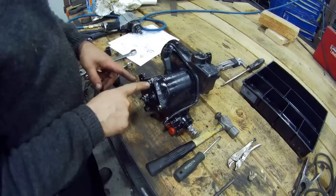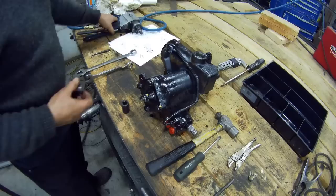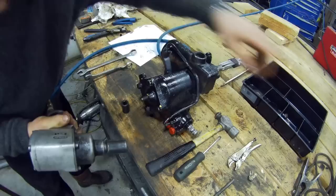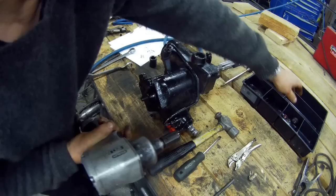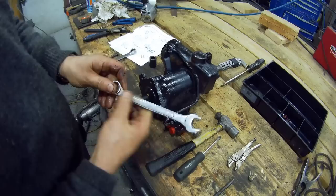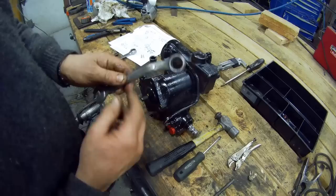The next thing is to take this locking nut off — that's 19mm — and these four bolts, which I think are 15mm. I'm going to cheat a bit and use an impact gun just to speed the job up. They weren't very tight. Another little tip: never be afraid to bend spanners. I bent this 19mm one to go on a left-hand drive so I could adjust the steering where you couldn't quite get a direct socket on it. When you get cheap spanners, don't be afraid of warming them up and bending them.